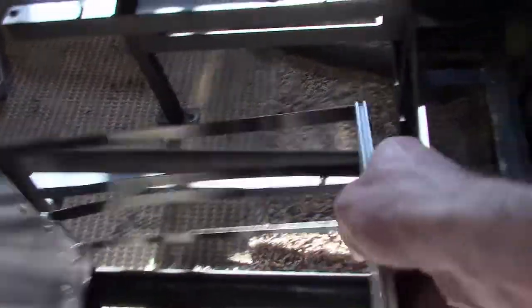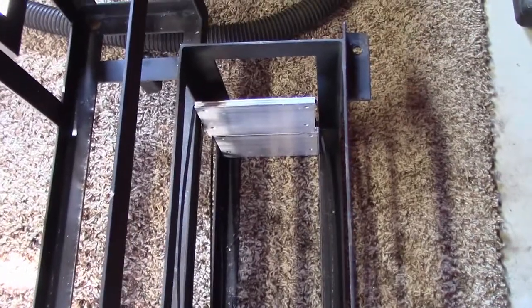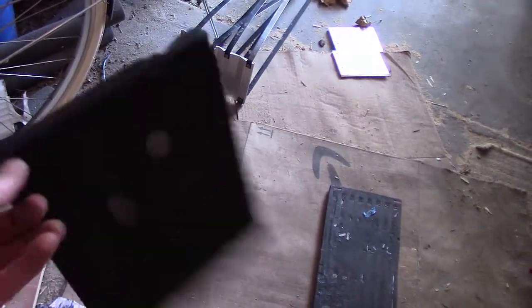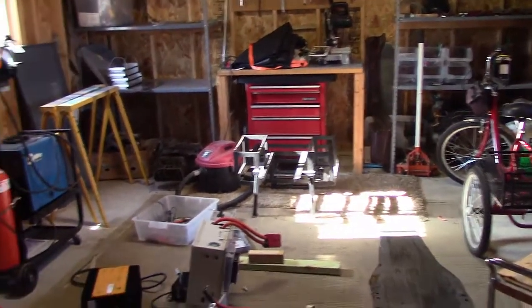Then you would drop the bundle into the cage. But as you can see, this set of cells would still loosely fit in there — these cages weren't designed to just squeeze against the plastic cell boxes. What I did to make it real tight was I bought a bunch of this half-inch pink insulation you get at the home improvement store for insulating walls, and I spray painted it black just so it's not pink. I put that all around and on the bottom of those battery boxes.